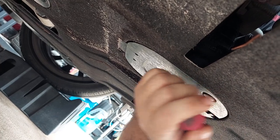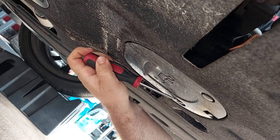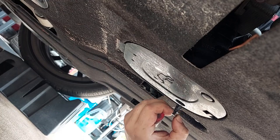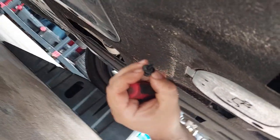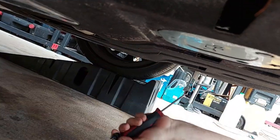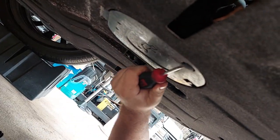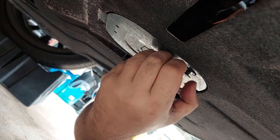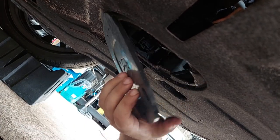Don't force it. If it won't go one way, come around and attack it from a different way. Once you got them lifted, gently pull. When you push this flat in, it spreads those prongs and makes it hold — like a drywall anchor. Now that that's out, this door will open right up, and there's your oil filter basket right here.